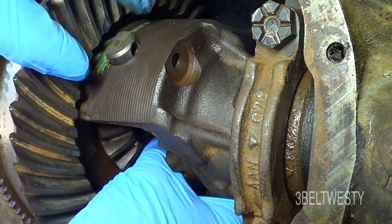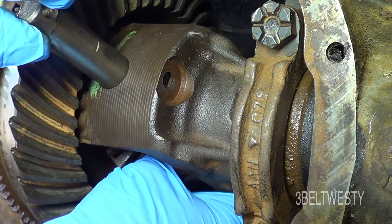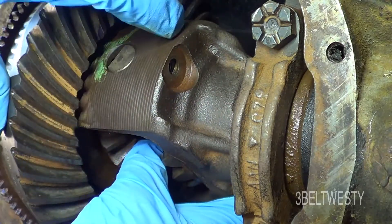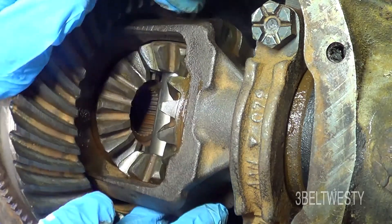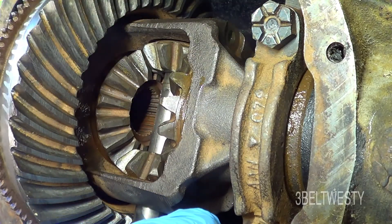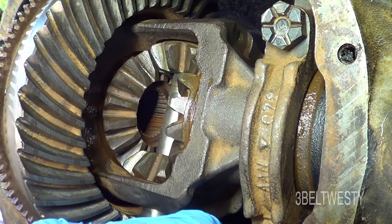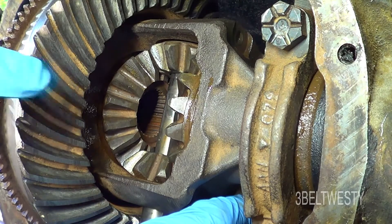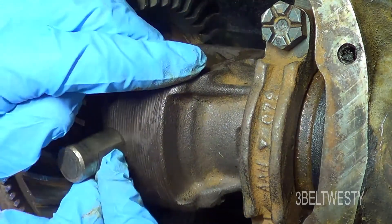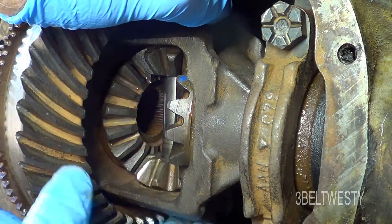On this particular one, the cross-pin will not clear over here — kind of surprised me, and that's the purpose of this video. I was able to get the C-clips out by rotating it around like this, pushing the axle forward, and then fishing this out. I had to rotate this one around and goof around a bunch of different ways and finally got the one on the right out — that was kind of a booger bear.